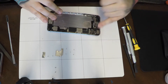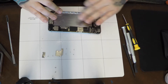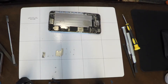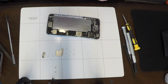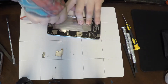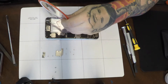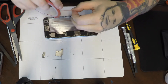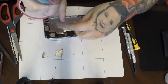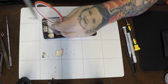Got that final pull tab out — this battery will come out and can be replaced. Right here I'm just wiping away the leftover alcohol, making sure it's dry. It's not going to hurt your phone, but you don't want to put a battery on top of wet housing. I use 2mm double-sided tape to hold the battery in place. Some replacement batteries come with their own pull tabs, which is convenient. If they don't, use 2mm double-sided tape specifically designed for this type of project. Do not use scotch tape or masking tape — that's not designed to have a battery set on top of it.